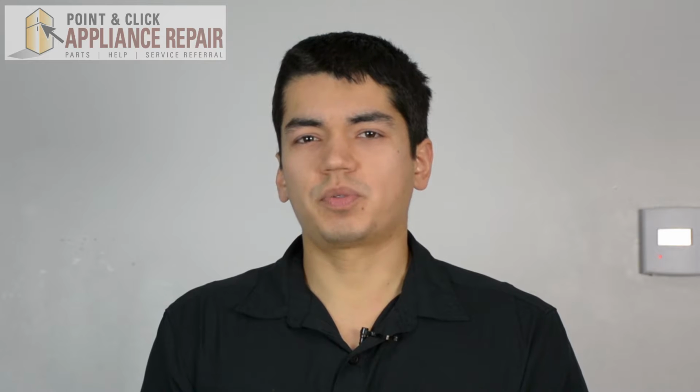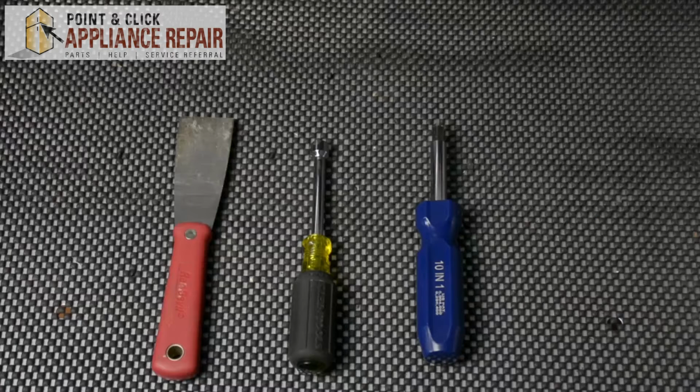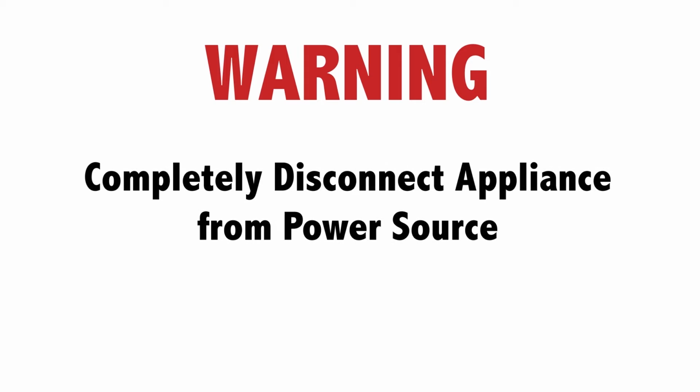Hi, my name is Bill, and today I'm going to be showing you how to replace the drum bearing support on your dryer. The reason why you might have to do this is because it won't tumble or it's getting loud. For this repair, you'll need a putty knife, a 5/16 nut driver, and a screwdriver with a number 2 square bit. Warning: before doing any repairs, please disconnect your power source.